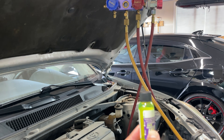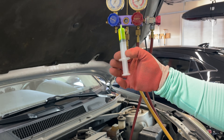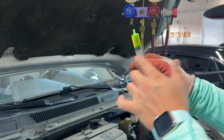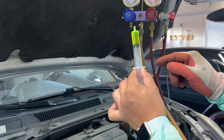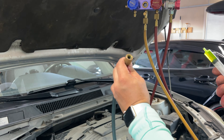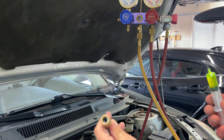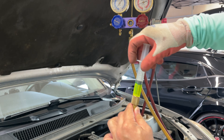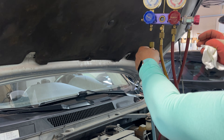I've got about five and a half mils in a small syringe here. If you're using the syringe method, just to keep things tidier and easier to put into the hose, you want to make sure you're using a new syringe that's never been contaminated with water, oil, or dirt, because that can end up in your AC system. In my case, I have these Schrader valve charging hoses that I'm going to take off my suction line and inject a little bit into the low side, then screw that back onto my manifold.